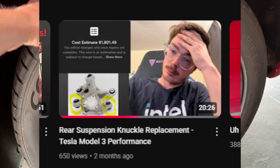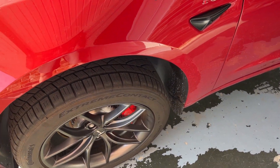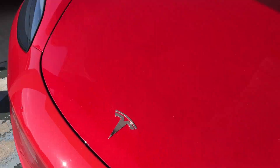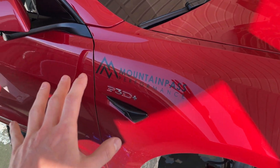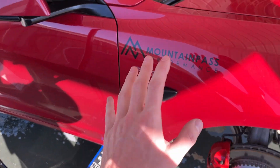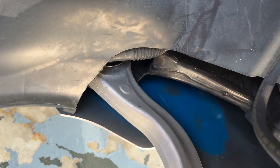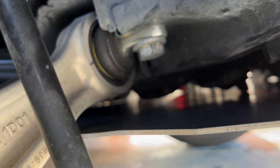It wasn't as hard as I thought but it was definitely a lot of bolts. Since I just redid that about 3,000 miles ago, around the same time I got these tires, I figured it was time to come under here and check the suspension torque. I recommend this for all Tesla Model 3 Performance owners — or just Tesla owners in general. You can find all the torque specs for the entire car on Tesla's website. I recommend going about five foot-pounds over whatever the torque spec is, because most of the Tesla suspension is held on by pure clamping force — like this bolt here that's held into the subframe just by clamping force on the bolt.